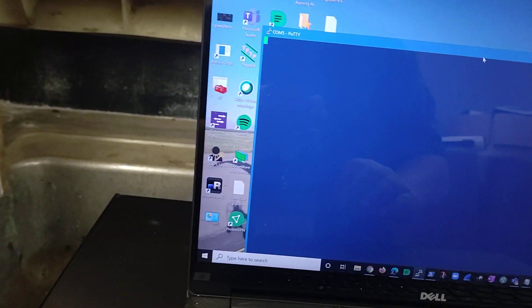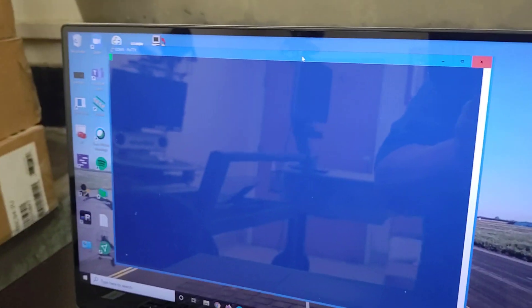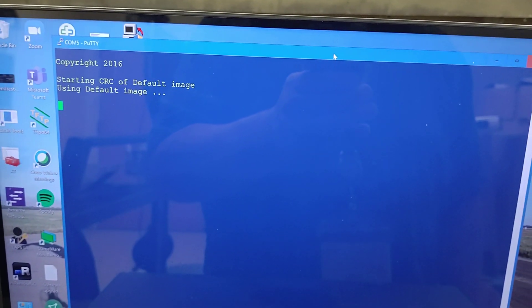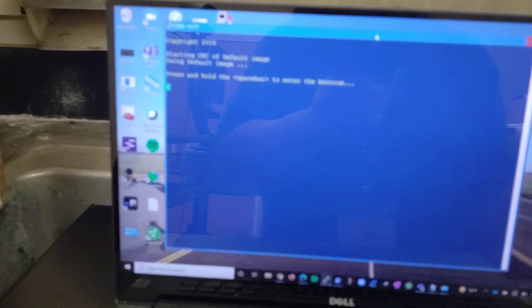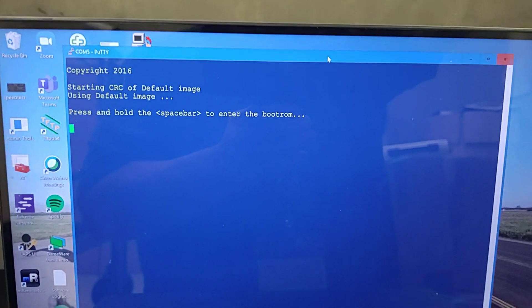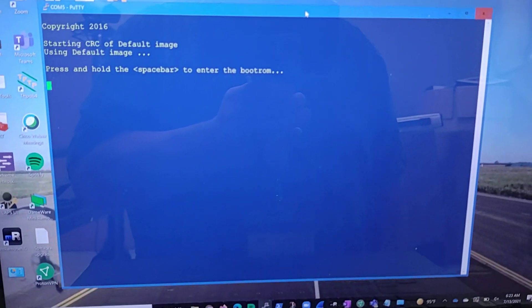Got that set up and loaded, and PuTTY is sitting here waiting to do something. Got the console cable on the laptop, terminal emulation software running. Now the only thing is to power up this switch and see if my settings worked. I see words! If you see something come up when you power up your device, then you're in good shape — you've probably got it set right. Go ahead and let it continue booting up, and then we'll do the last check, which is to make sure it responds to keystrokes. If it doesn't, you may have to check the manual for any serial settings you missed.